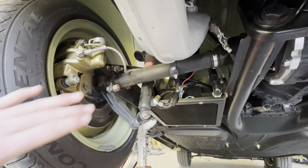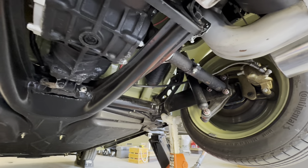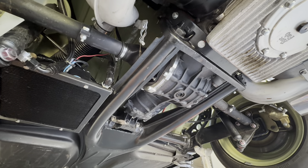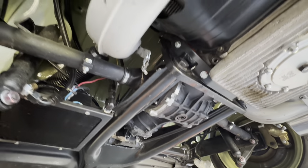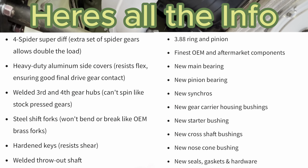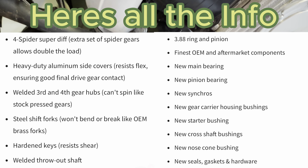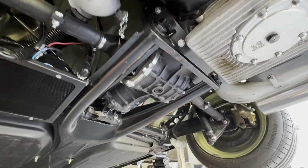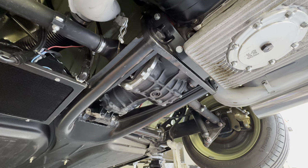Here's what the backside of my wheels look like with the brakes on both sides. While I'm under here, I'm going to touch on my transmission — that is a Rancho Transmissions four-speed transmission on heavy duty swing axles. The gear ratios are a little bit different — I'll put them up on the screen — but my first gear is meant for launching, and my fourth gear is meant more for highway speeds, because original Volkswagens weren't the best at that. Otherwise it's mostly based off the original transmission still.